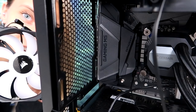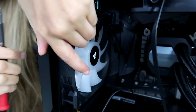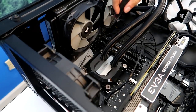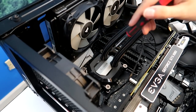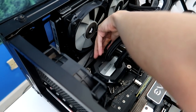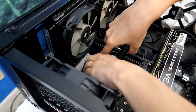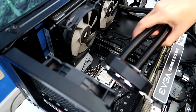I'm going to go ahead and install this fan in the back — it's just a little exhaust fan because this case does not have one. Alright, I went ahead and cleaned out the fans up here and moved the wires accordingly. Now we're going to go ahead and take out the CPU cooler and reapply thermal paste. It's probably okay, but you know what — we're going to spoil him. So why not? Actually, that thermal paste was pretty okay, but I'm going to go ahead and reapply it anyway with isopropyl alcohol.